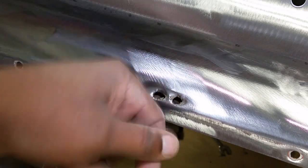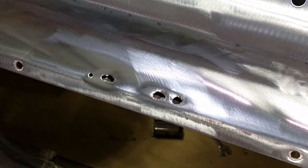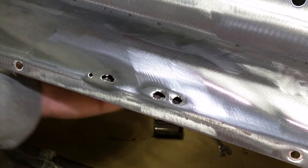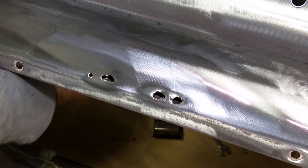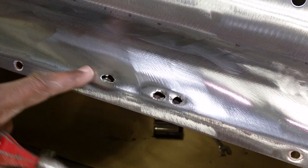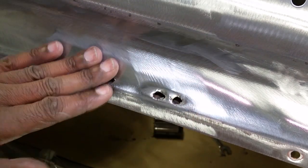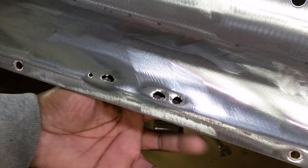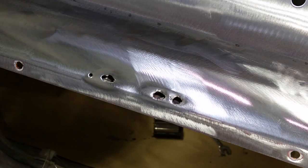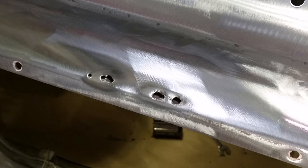Take something and get that scaly rust out, blow it out real good. When you finish the car, I have a little tool I made — I'll show you some other time — that I can get inside there from the back side of the trunk lid and spray my rust inhibitor or encapsulator. It lasts forever; it's guaranteed to outlive you. After you get your body work done, go behind it and spray that rust encapsulator — it encapsulates it and it works well.